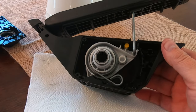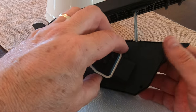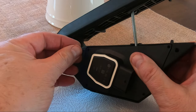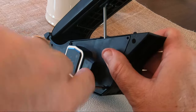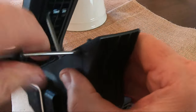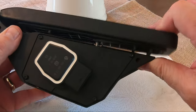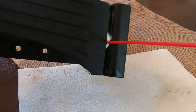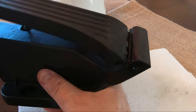Once I washed my hands, I began the reassembly of the case and sensor. Take care with this part — if this gets damaged, you're not going to be driving this vehicle to the repair shop. My local big box parts store gets $147 for this pedal assembly. Hex screws were hand tightened in a crosshatch pattern. So far so good — no whistles or squeaks. One last pivot point I'm going to lube is the hinge from the bottom of the pedal to the case. It is sprayed and allowed to penetrate, then wiped dry.